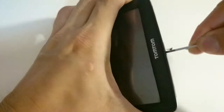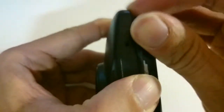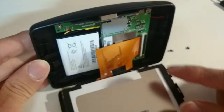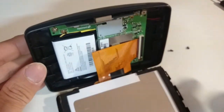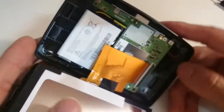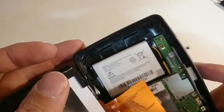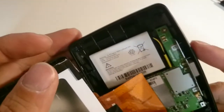Now I will try to open up the top part, and the frame should pop out without too much difficulty. There goes the screen — you can see it's attached to the main board by a flex cable. And you have the battery right here. It appears to be a 3.7 volt, 3.1 watt-hour lithium-ion battery, and it looks like a standard packaging.